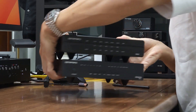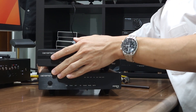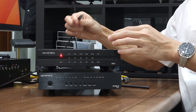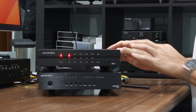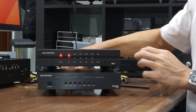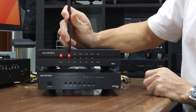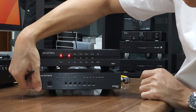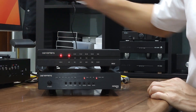Now I'll connect the power cord for the Iris DDC, and the USB cable must be connected to the Iris DDC so that the computer sees the Iris DDC. The Iris DDC will process the signal and output I2S over this short HDMI cable to the Aries 12. The Iris is on, the USB LED is on, and 44.1 kHz is detected. Flip the switch at the back to turn on the Aries 12 — the standby LED comes on. Hit the standby button to turn on the Aries 12.